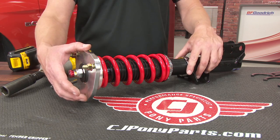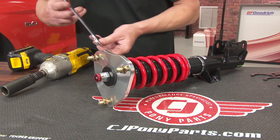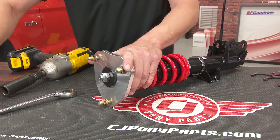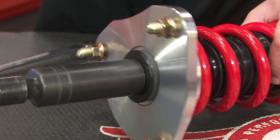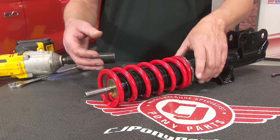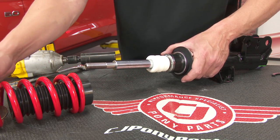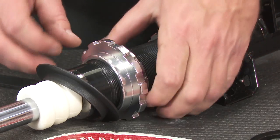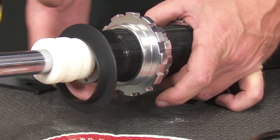Now, as we said earlier, these can be installed as they come out of the box with the alloy plates. But in this case we're going to use the camber caster plate. Start by removing the adjustment knob — take a reference of what it's set at now so you can double check after. Next, remove the nut that secures the top hat to the shaft, then remove the bearing assembly. We'll remove the spring so we can back off the collars a bit so we don't put too much preload on the springs when we reassemble. We'll back these collars quite a ways down, and once we have the new camber caster plate on top, we'll reset the preload.